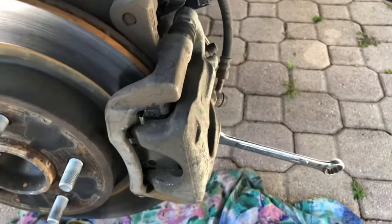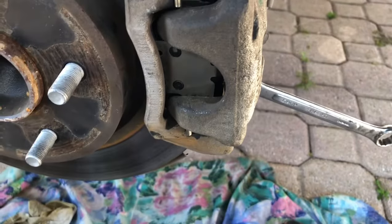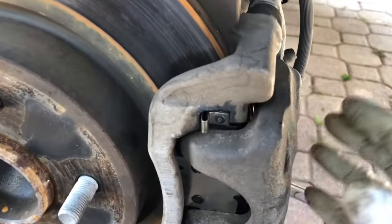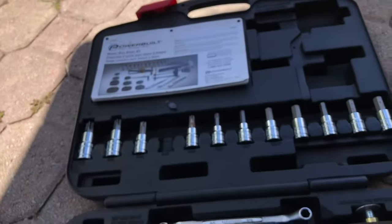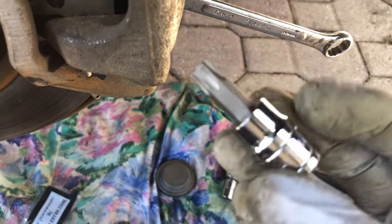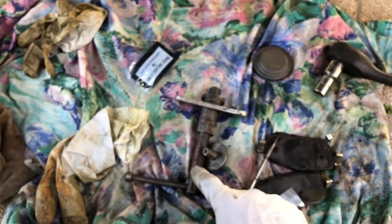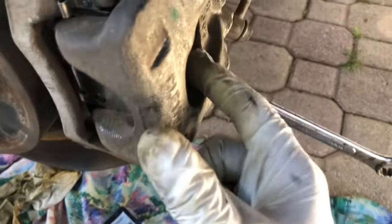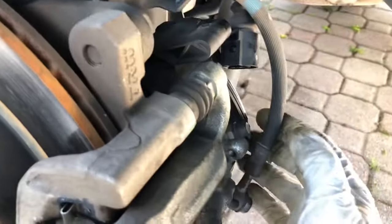Okay, one thing to tell you: when you twist the caliper in, it's gonna go to a point which is gonna be stiff and hard, but you're gonna have to go more in because you cannot put this on otherwise. So what you do — this loaner tool comes with all of these attachments, and you're gonna have to use a T-47. You put this in like you're tightening the caliper, pushing the cylinder in, and the motor is off.